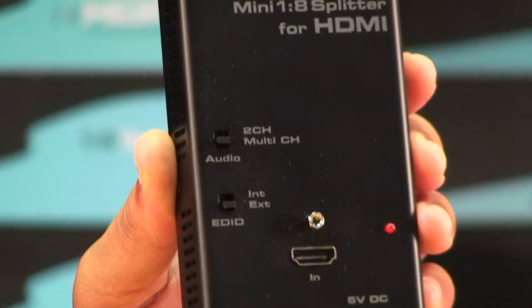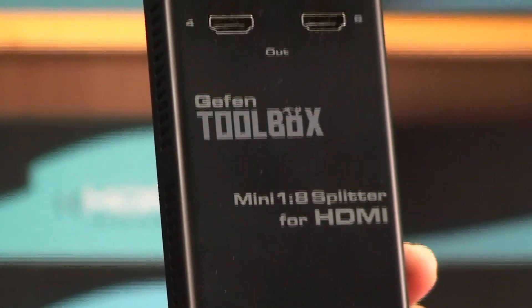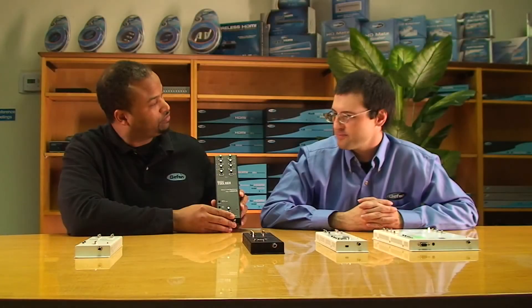The next product is the 1x8 Splitter for HDMI. Since we're on the subject of splitters — my displays are made by a multitude of manufacturers, they're all 1080p but quite a variety. Is that going to work, or do I need the same TV? This will work perfectly as long as the native resolution of your displays are the same. If you have, say, a 720p projector thrown in there, you need to put that on output number one so all displays run at 720p.